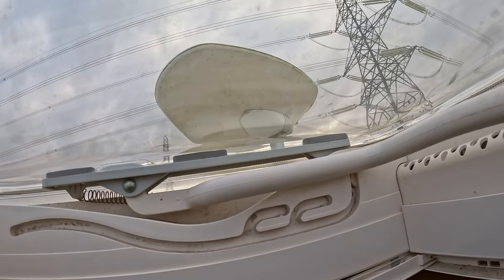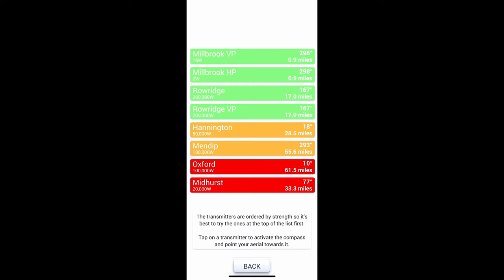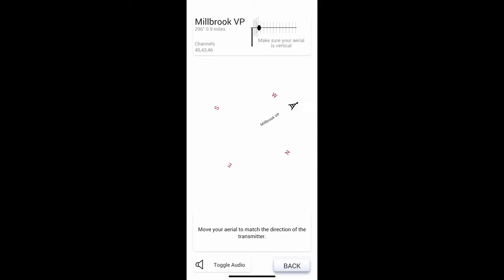Another way is to use an app. This is the app Antenna Finder, which we use when trying to find a good signal for the TV. On the first screen you have two options — you either put in the postcode or location, or use the current GPS location option. Once you click that, you get all the different locations where you can get a signal, listed from strongest to weakest — always choose the top option. That takes you into a compass which points to the direction of that antenna so you can pick up the signal. Then it's just a case of getting your TV aerial pointing in that direction, locking it in place, and tuning your TV to see if you can pick the signal up. If you're not getting all channels or it's flickering, check that your amplifier is turned on and check your cabling from that to your TV.